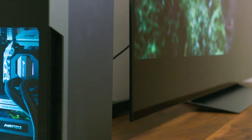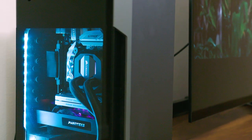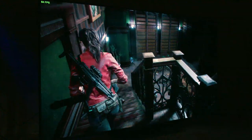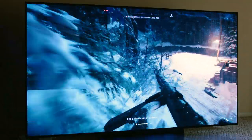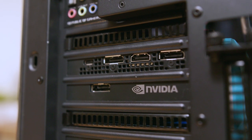While this is super exciting at first glance, unfortunately you can't actually utilize that on a PC because the current generation of RTX graphics cards from NVIDIA and even the RX Vega GPUs from AMD do not support 4K 120Hz over HDMI 2.1. They only support it over their DisplayPort 1.4 connection, which is a port that the TV completely lacks. DisplayPort's just not very common on TVs. What this means is even a high-end gaming PC can only game on this TV at a maximum of 4K 60Hz or 1440p 120Hz, over the HDMI 2.0b connection that both of those video card families have.